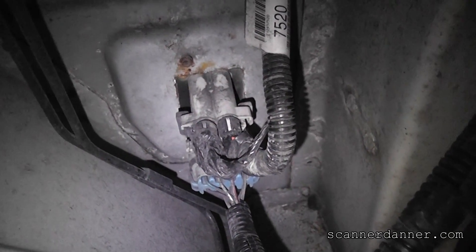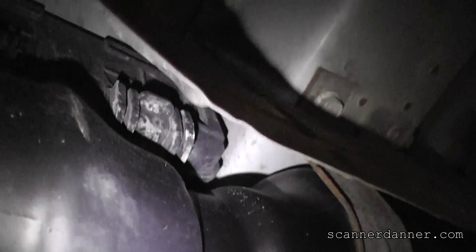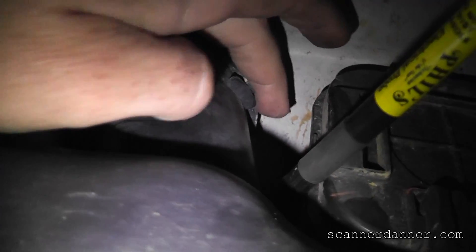The next step is to do some checks at the solenoid above the tank. Here is the fuel tank as you follow the camera — this comes around the middle of the vehicle. There is the exhaust system right here and the other end of the tank. This is the filter part of the vent. The electrical wiring is way back in there.